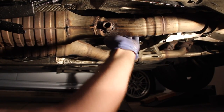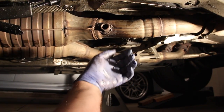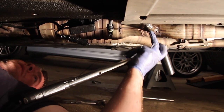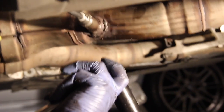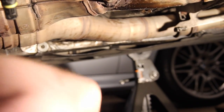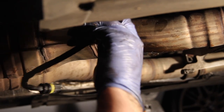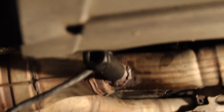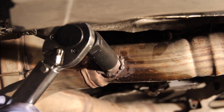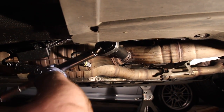You want to probably do this when the exhaust is cool to touch. When it's hot, the metal is going to be harder to work with and a lot more painful if you touch it. Your torque spec for these is 50 newton meters, which is approximately 37 foot-pounds. Set your torque wrench, then use that special cut-out socket. Position the socket first and then the torque wrench because it's big and clunky — shove it in there. It's going to be tight on the wire but it's designed to do this. Position the torque wrench and torque her down.